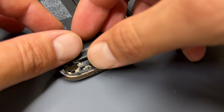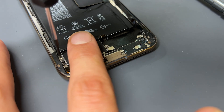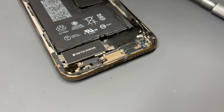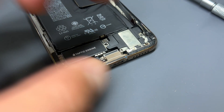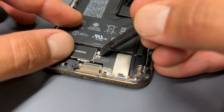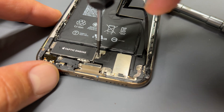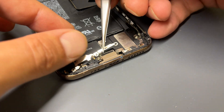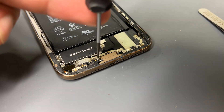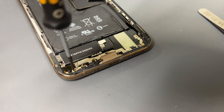Let's go ahead and install the Taptic engine now. Use the plastic spudger to make sure that the flex cable clips into place nicely and then secure it with the two cross-head screws on the left-hand side. We'll reinstall the loudspeaker first — that's held down with one cross-head screw on the right. The flex cable for it can be reattached using the plastic spudger before we reinstall the little metal shield and single cross-head screw. This metal shield goes on top now, and there's another one just to the left. Install the tri-wing screw just below the Taptic engine and the two cross-head screws in the bottom left corner.